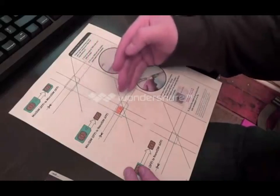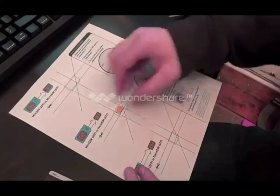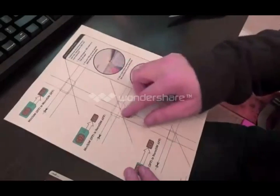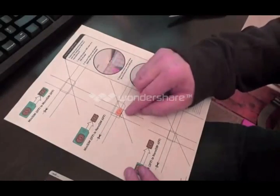So as far as the lateral cuts go, you want to go right along the edge of the metallic portion, removing the plastic sides. I've got a bunch of scraps over there, which wouldn't tell you much at this point, but basically you want to follow the inner square on the diagram from the mini SIM to nano SIM portion in order to get down to this nano SIM right here.